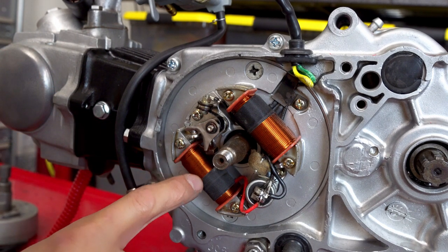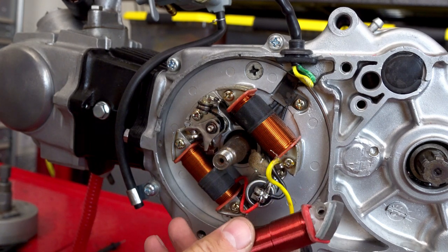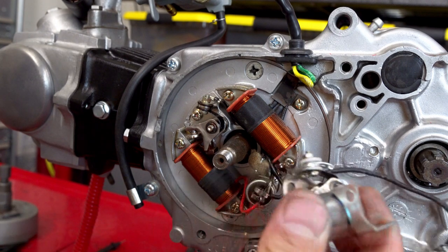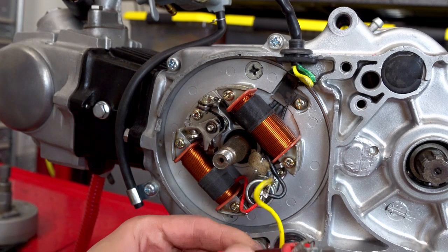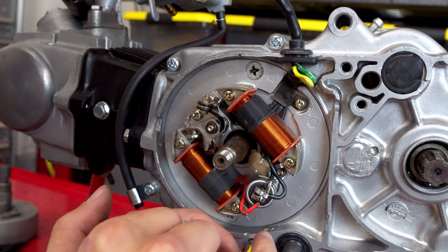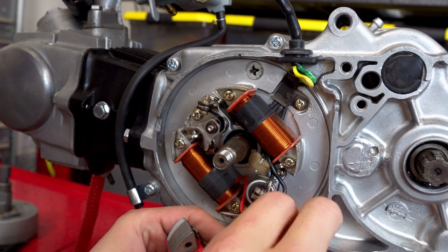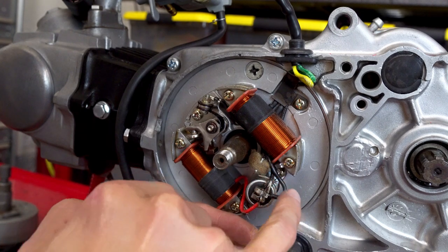Close up here: this is the lighting coil on the top, and in my initial test I was getting the right voltage out of that. So it was the main coil and then either the condenser or the points that was causing my problem. This was really frustrating because I had two of every single thing to try — a different coil, a separate set of points, and a different condenser.